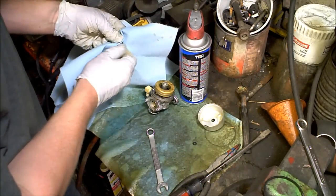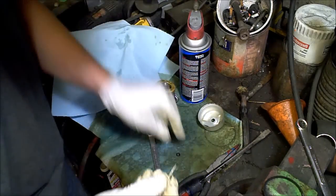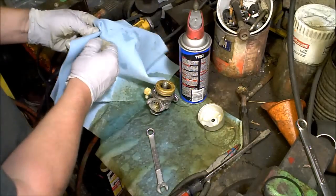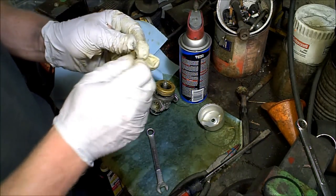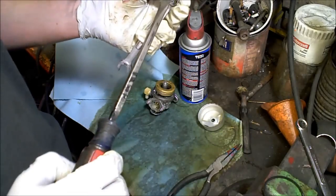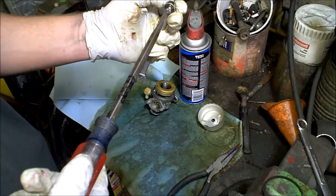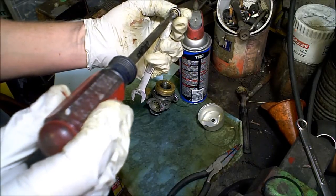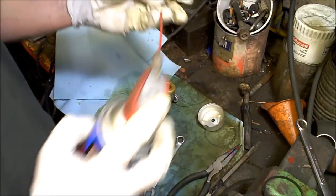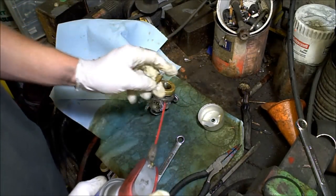Clean off the tip of the needle, put the brass washer back on, then the O-ring. Reinstall it and put it back on the wrench how I had it — snug. I put it just a little bit over one turn: half, one, a little past noon, past six — one turn out. I might have to adjust it from there, but that's how it was set from the factory. Spray down through here and you get it to come out of both those holes. Main jet's clean now.